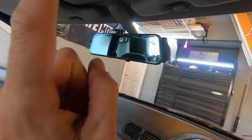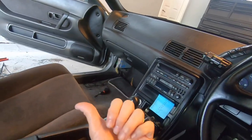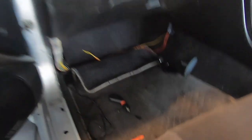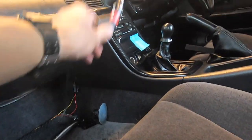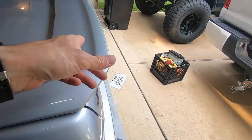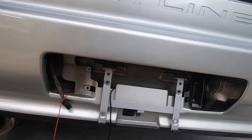The rear cam cable I ran back that way. This thing had a CD changer in it, so I just used that to fish all my wires back to the back. Here's the power cable — there's some wiring from the CD changer. I'm going to hardwire this in later when I do the radio. I ran the wire out through here, to the end of the trunk, threw a grommet in the trunk, and back to the camera.